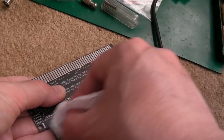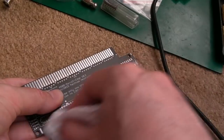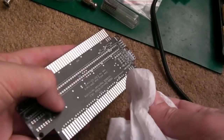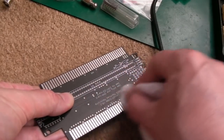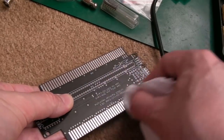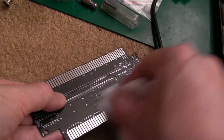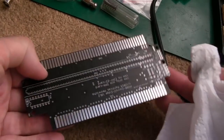So one test I might do, I'll disable the RAM on the A590, connect the A590 up on the pass-through connector, and then connect an 8 meg RAM board up to the slot. Now in theory that might work. I don't know whether it will, because it says 1 DMA card, and actually those are 2 DMA devices. I'm pretty sure the RAM supports DMA, could be wrong.